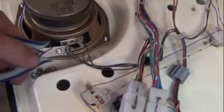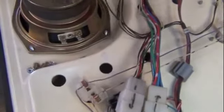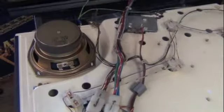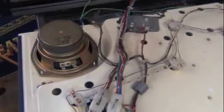I recommend snipping the wires — you can always re-solder them. Because the harness is integrated so much into the back box going through these connectors, it actually makes sense to leave the harness there in the event that you would choose to reverse the installation.